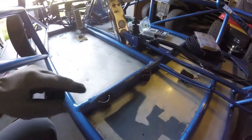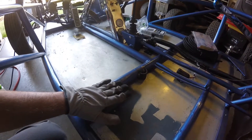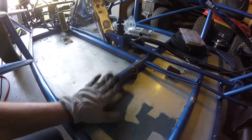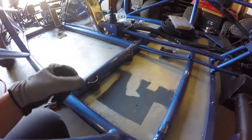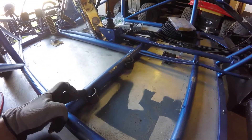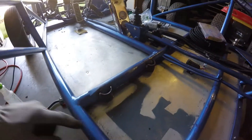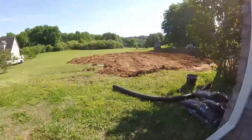Update time — I've got these two support pieces welded in. That's where my plate is going to sit on top, and I'll weld it across the top of that and halfway across the top of this bar for a little extra reinforcement — it was looking a bit flimsy, I'm just being overly cautious. The plate doesn't come all the way to the top of the tube, so I'm welding right here at this grind mark. Got it all mapped out where the seat will sit.